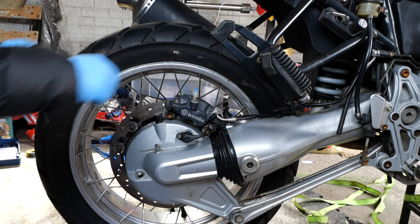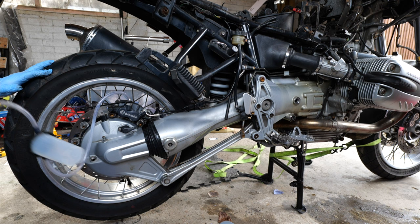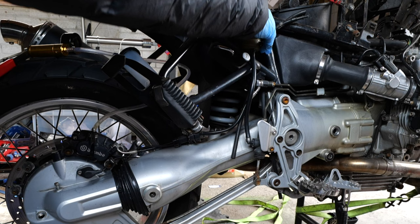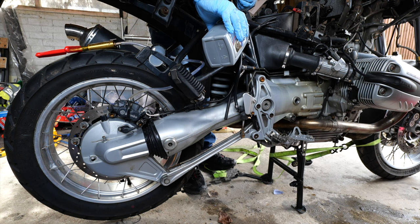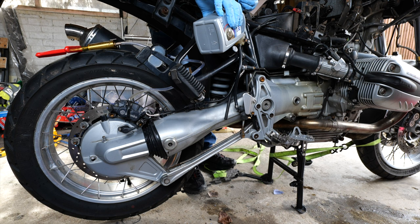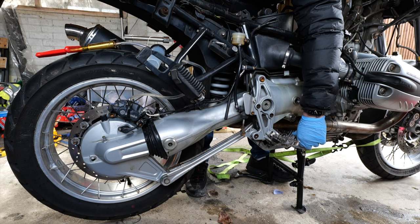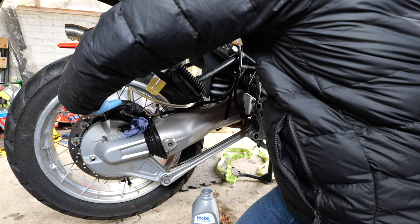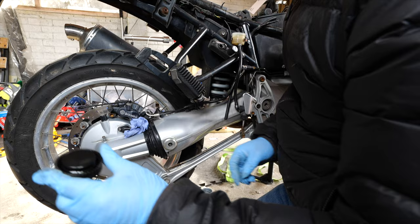The last thing to do then is bleed the brakes again — one of my favourite pastimes. The weird plastic thing was gone because I bought myself a nice new nipple cover. This is the best brake bleed kit I've ever used — you just connect the pipe, squeeze the pump a couple of times and it creates a little vacuum. Once you open the nipple it sucks the fluid straight into the pipe, so all you have to do is keep squeezing the pump or press the brake lever to continue bleeding. Got a nice good bite on that rear brake now, really pleased with that.